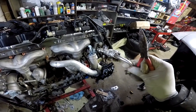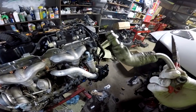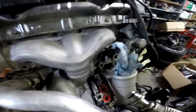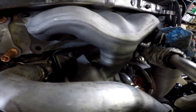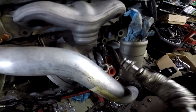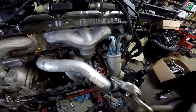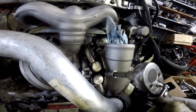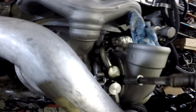Same thing goes for this side — I cleaned up this line, changed the o-ring, and oiled it. It's going to go on the top like that, so I'll pull out this plug because the top line goes first and then the second line goes on top. The front was way easier — got those in, so I'm going to lock this in and torque them down.